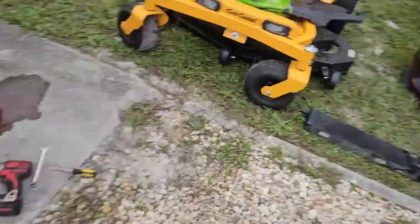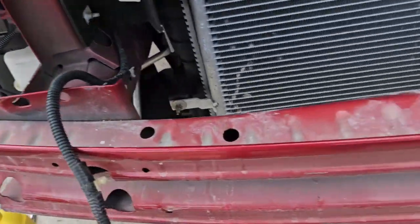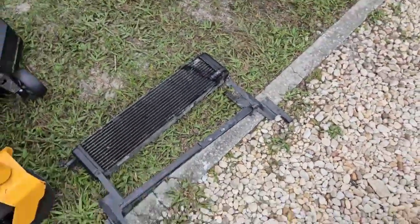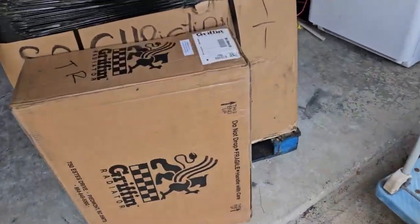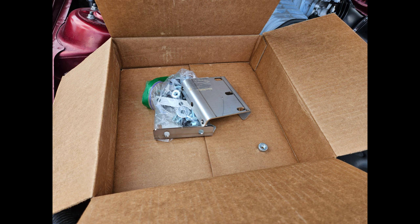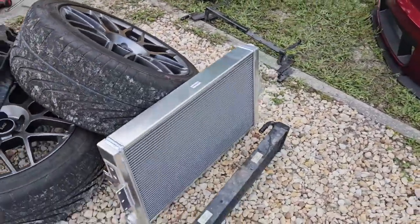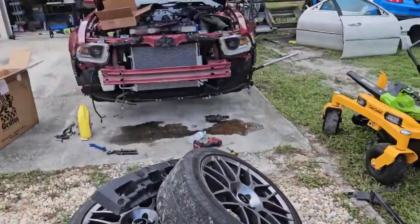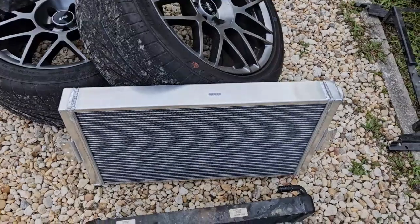The stock heat exchanger is out. The stock bracket just has these little resting lifts that sit over the higher part of the bumper support. There are four 15mm bolts — one, two, three, four — take those out and away she goes. There's the old stock assembly. Now it's all clear in the front. I'm going to open up the new one and see what's required to make it fit. Look at that size difference — I think back-to-back on performance pulls it will definitely be night and day. This is like a full car radiator compared to the little dinky stock one.